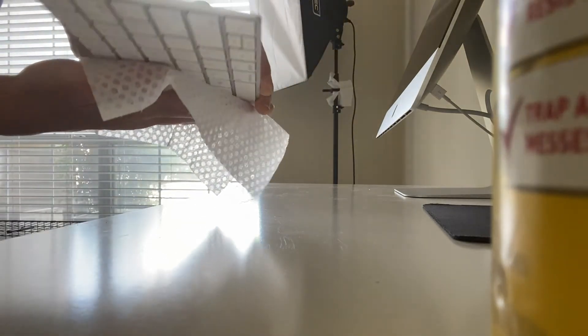As an extra measure, when you're cleaning a keyboard, it's a good idea to turn it upside down to minimize the possibility of liquid getting under the keys. After wiping down your device, it's best to wait five to ten minutes before plugging it back in or putting in the batteries.